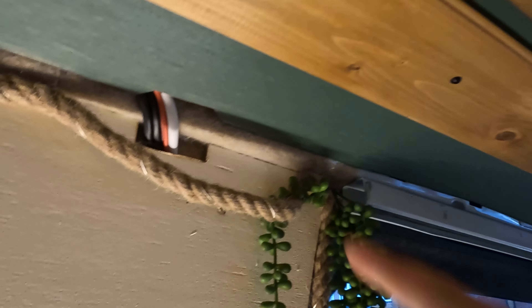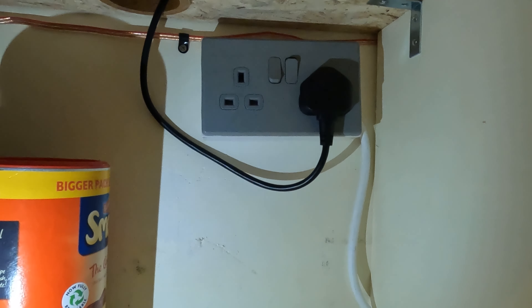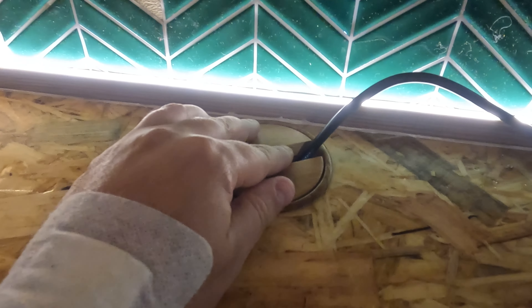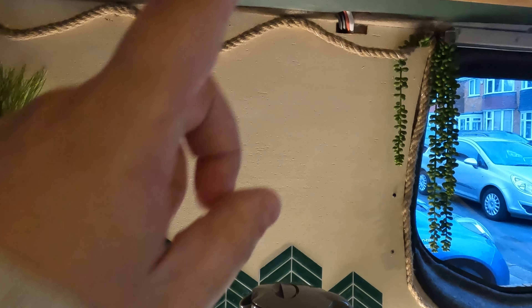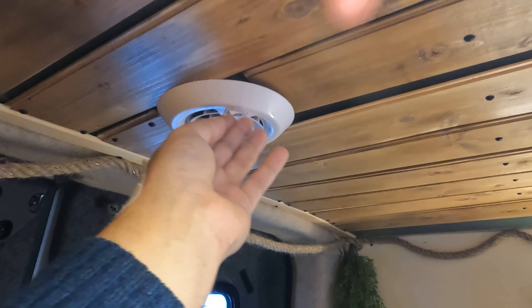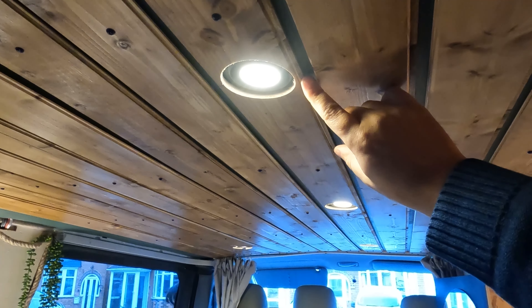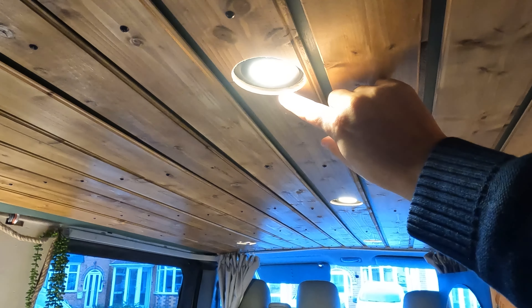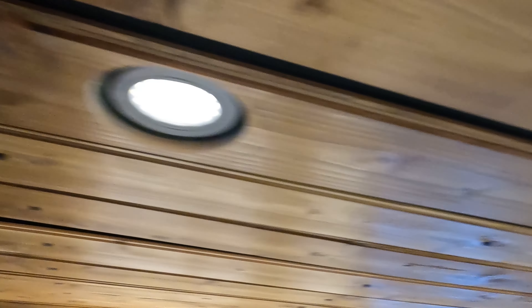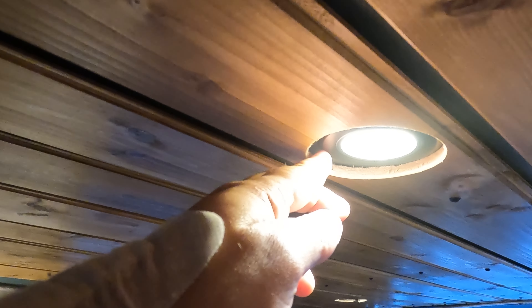We also have 240V on the opposite side of the van, fed over the ceiling and down to two plug sockets under the counter where we plug in the kettle, induction cooker, and anything else we need. We also put a small hole in the cupboard so we can pass plugs through for appliances on the surface. Coming down from the ceiling is also a 12V line into a small fuse box, powering the ceiling fan, both LED strip lights, and USB plugs towards the back. We have four touch-dimmable spotlights in the ceiling — low wattage, warm light, really happy with them.